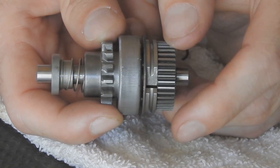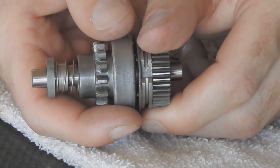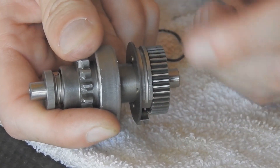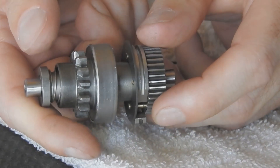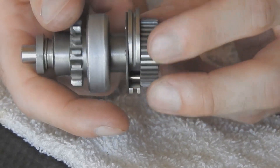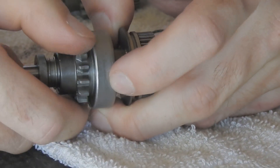The basic order of operations is: you start the starter motor spinning. The resistance of this part to accelerating forces it out. The centrifugal force of the starter motor shaft spinning forces this collar out, locking it in place. As it spins the engine over, the engine starts. The load here changes directions, and this just free spins.